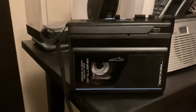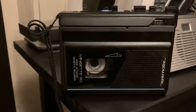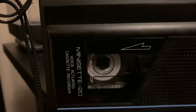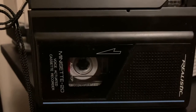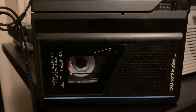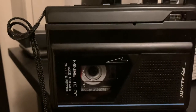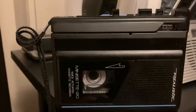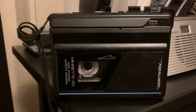So let's say you are trying to rewind a tape and it is not rewinding easily. Of course, now that I try and do this demo, it's rewinding easily — that's funny. A minute ago it was kind of hanging up. You know how some older cassettes will have more friction and sort of get stuck, or sometimes a combination of that and the cassette player starting to wear out, with the rubber parts or rubber belts starting to wear out.